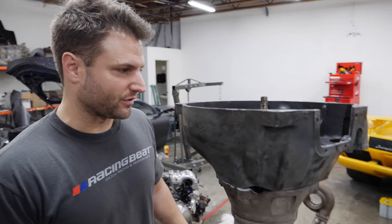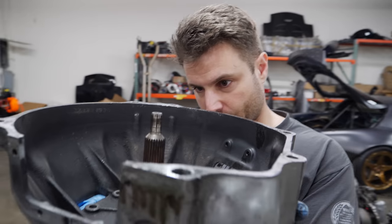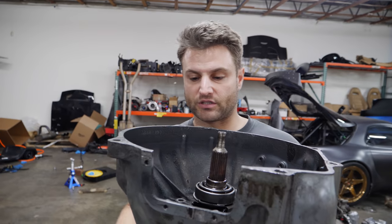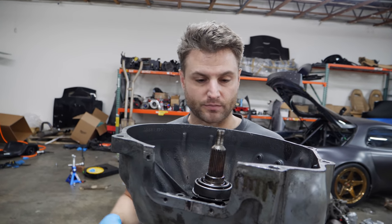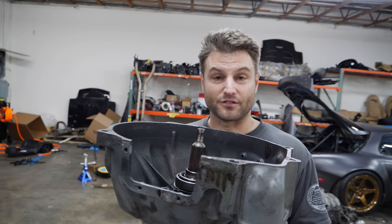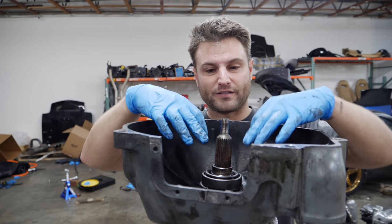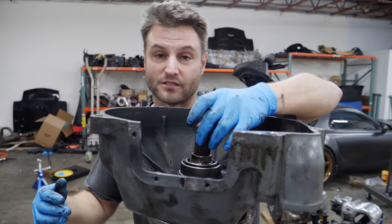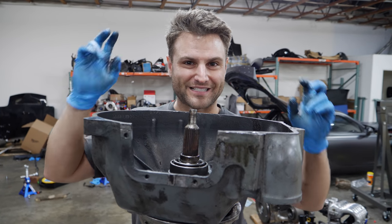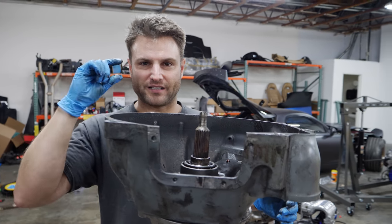It gets scary, but after a while you just suck it up and get it done. You see a lot of other YouTube car projects just buying parts off the shelf and replacing existing parts. Even though this is just a Corvette with a rotary engine to some people, this project requires real engineering. There's a lot of thought that goes into what looks simple — like getting a clutch. What's the offset? What spline are you going to use? Because these are not FD splines, not Turbo 2 splines — these are T56 splines. Heights, depths — all of that has to come into play just to make one adapter piece of metal to connect it all.